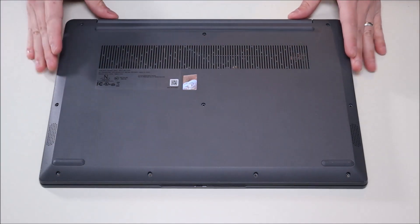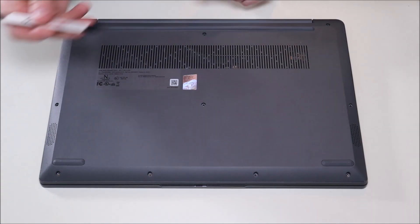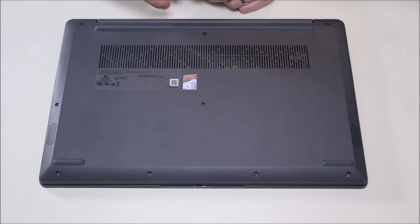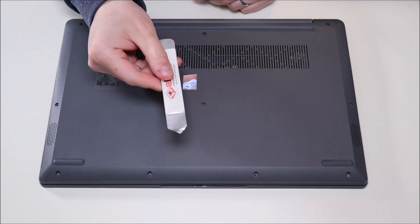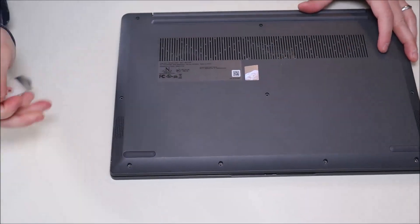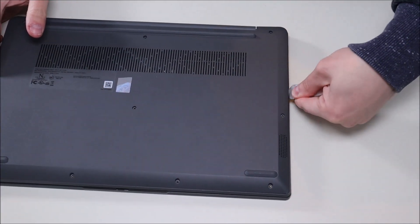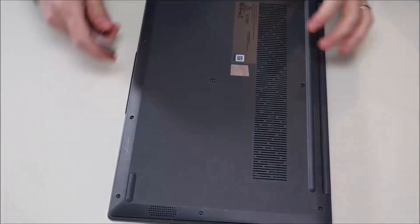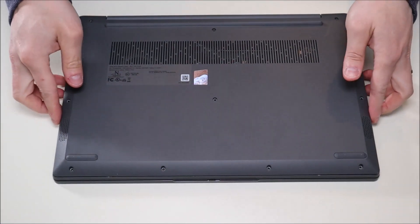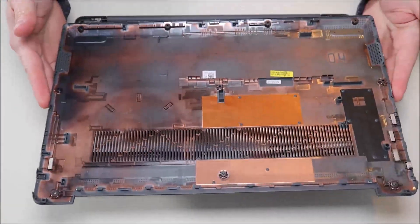If you do that, you can damage panels — you may even damage electrical components. Now that I have all my screws out, I'm going to take a small flat metal pry tool. I'm going to go along the seam of the bottom case and the palm rest and gently pry this off. Be careful not to put it in too far — you don't want to damage any components in there. I think I have it all up; I'm just going to gently pull on it, and there comes up your bottom case.